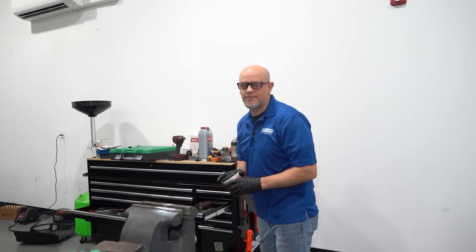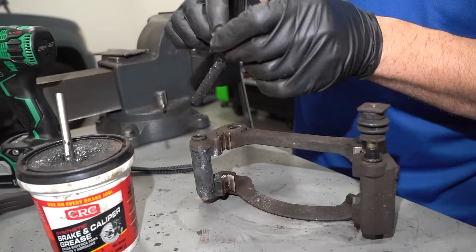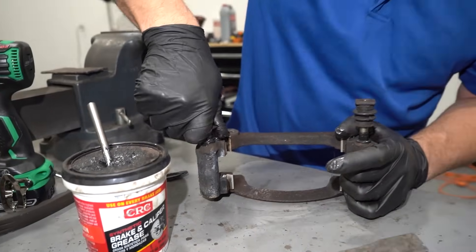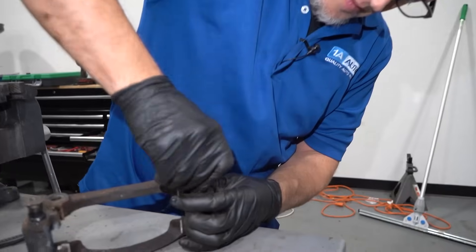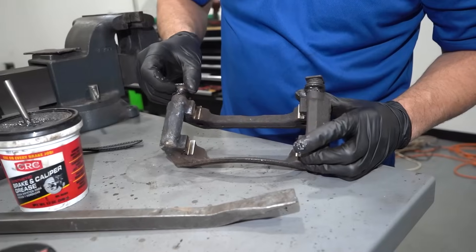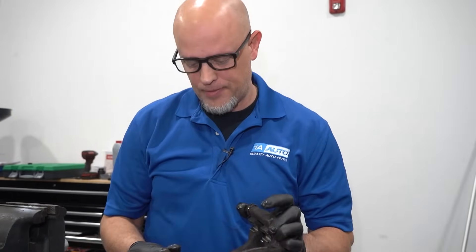Let's get some grease. You want to grease up the pin real good. And again, you want to get a new boot for this — you don't want to just leave the boot off. That's looking good — get some grease on that pin also. Now with some new boots, it's all cleaned up. The caliper slides — where the pad clips go — have already been cleaned up. We could reinstall this in the car, but because of that little bump right there it's swollen a little bit. We're going to get a new caliper and bracket, but you could reuse this if you had to.